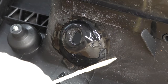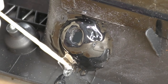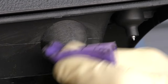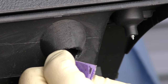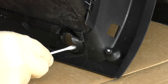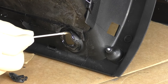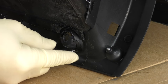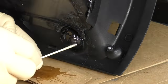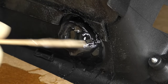Even though there's not a ton broken here, that whole layer of epoxy is going to reinforce the backside of our glove box mounting point so we don't just have a crack in the plastic. I am taking care not to completely fill over the hole that our screw is going to go through, so we don't have to drill this one out. For our final top mounting point — the process is exactly the same. Using sandpaper, scuff up the entire place we're going to apply epoxy, then rubbing alcohol to clean it. I did find part of this mounting point, so we have a little extra plastic to work with. We'll get a base layer of epoxy down, set our broken piece in, fill in the gaps, and then try to set some epoxy over the top of the big opening and let it fill in. We'll have to wait and see what it looks like once it's fully cured.